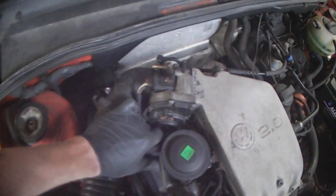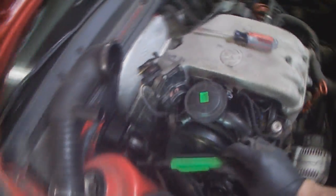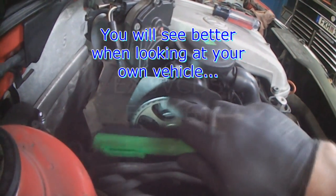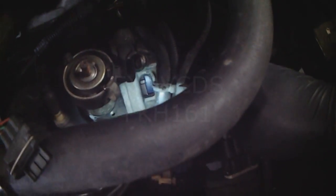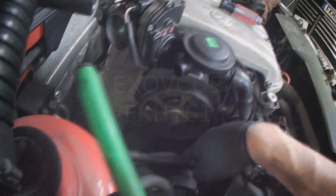There's the evap purge solenoid, and the fuel hoses and vacuum hose just pop out; then the cover comes off. Now we can see the OT mark with an arrow and the camshaft OT mark right there — the cam is slightly off but it's close enough because the zero is right where it's supposed to be. So now we know that number one is at top dead center. If it were at number four, this mark would be down at the bottom.